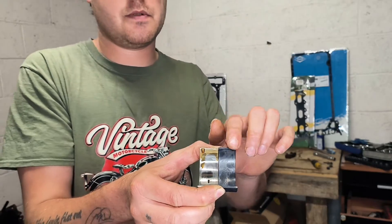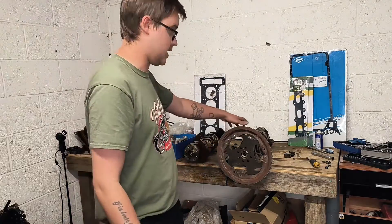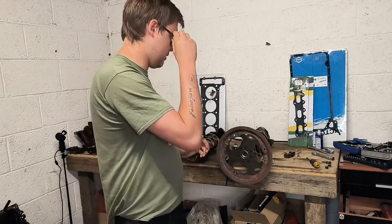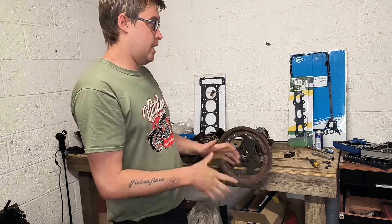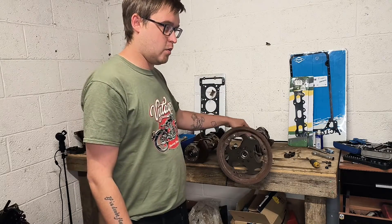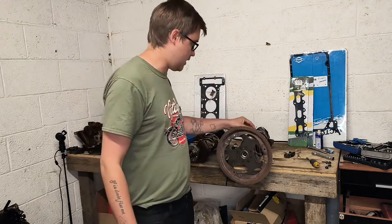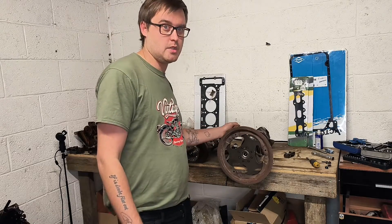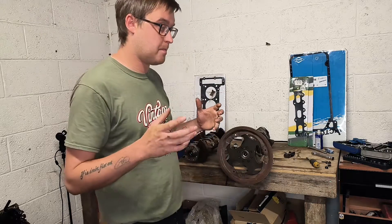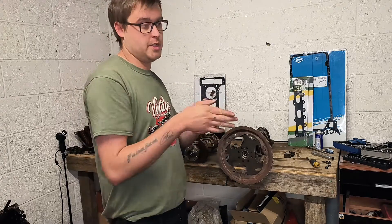There is a way to sort that, but this is pretty much only a test mule crank anyway — it's been sitting out of an engine for far too long and could do with polishing again. Because this has been reground, I can't do anything with it. What I need is an unmachined standard crank that I can have the con-rod journals machined to the tolerances I need to account for the thinner bearings.